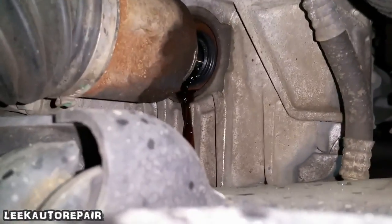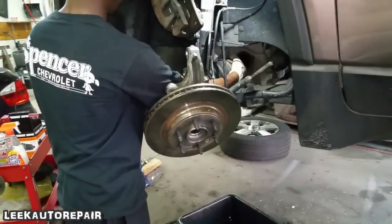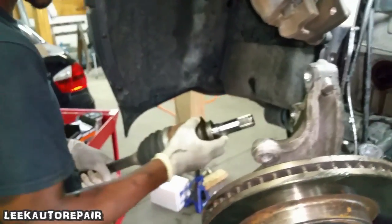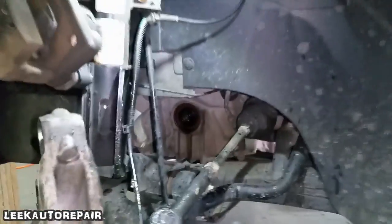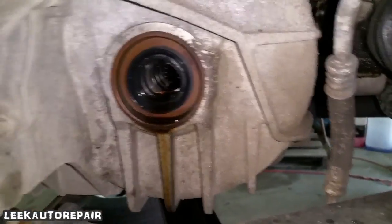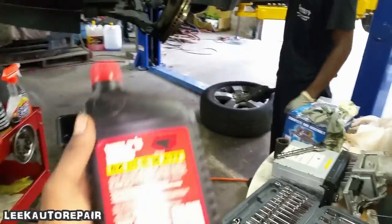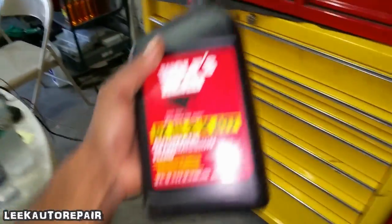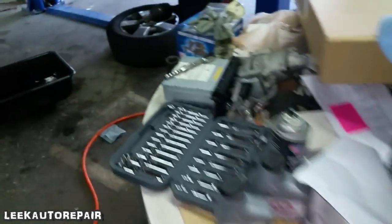Must be a mechanic. That's my fault for talking shit — a fucking transmission fluid is going to come out. So make sure you got your transmission fluid on deck. That shit happens when you take the axle out — it's fine. Y'all saw what I did. I got the shit popping. Now you may proceed — pull the axle out. Show them the axle — that's why transmission fluid leaked out; it was pretty much sealed when the axle was in there. For this car, it's a GM General Motors product, so most of them take Dexron 3, 4, 5, or 6 — this one's compatible.